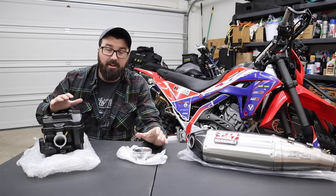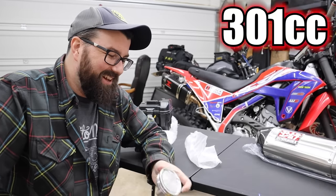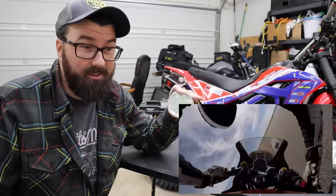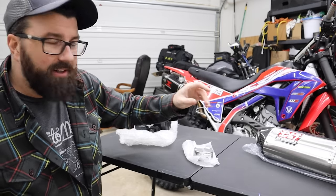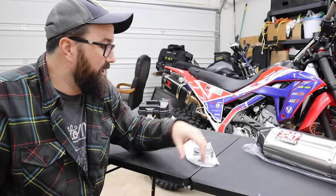Let's take a quick look at the actual parts going on during this build. The piston from JE Pistons — Ari worked with them to develop this piston. It's going to bump the compression a little bit and increase the bore a little bit. It's a forged piston and it's going to increase our engine size all the way up to 301cc. The actual size of this engine is a 286, so this is a bigger bump than you might think. It'll also bump the compression a little bit. This is a cylinder with a steel sleeve inside — I was shocked when I heard that. I've already found a local person who knows what they're doing. We're going to bore it out; it's only going to cost me about 80 bucks for boring, and they'll gap the rings.